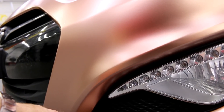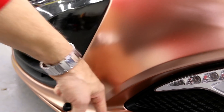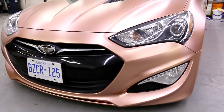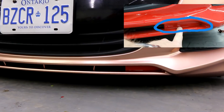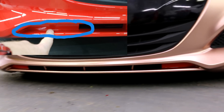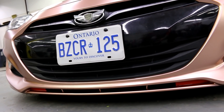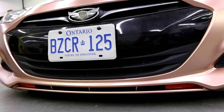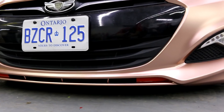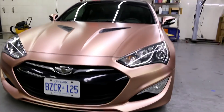You can see the seam slightly right there. This is a very deep recess — we're getting into about 60% stretch. Our high points are only right here, so we'd be stretching the film quite a bit if we stretched it all the way in. So we have to put a relief cut and do an inlay in there. They've asked me to leave that area red — that was one of the areas not supposed to be resprayed. Each one of those little prongs holding the front lip are meant to be black, but I wrapped them because they're really small pieces and it just looks better.